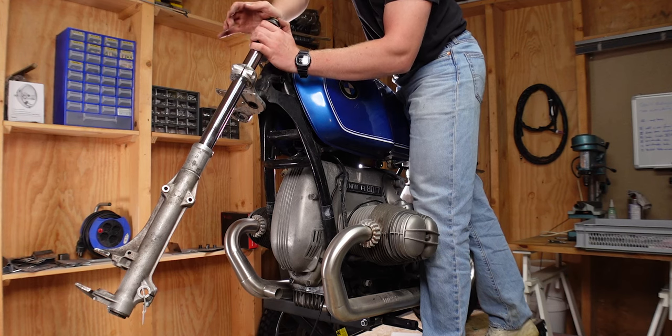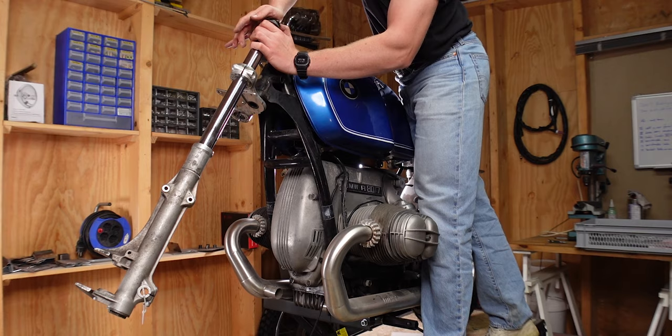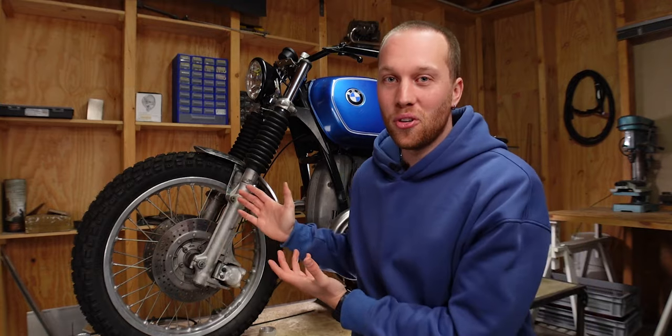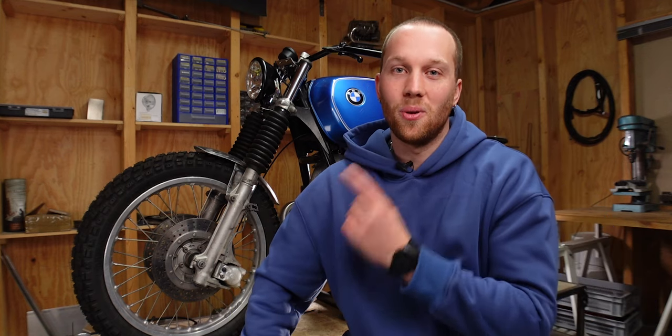This actually works quite nicely — I'm holding the nut down with my thumb and then twisting it with the palm of my hand. And that is how you can lower your front forks the relatively easy way. It might be hard to tell on camera but it definitely makes a big difference to the overall line of the bike. I might have been a little conservative with the spacer height — next time I would probably go for 40 millimeters or so. I hope this video helps you to lower your own forks. Good luck with that, and if you want to watch another video check out this one right here. As always, thank you very much for watching and I'll see you in the next one.